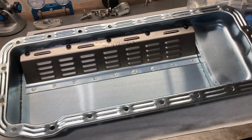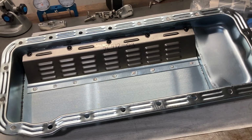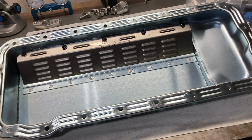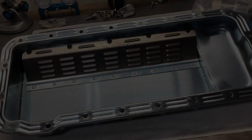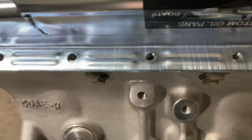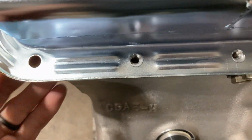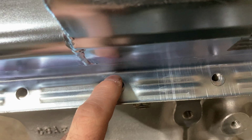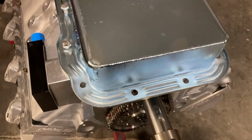While the engine is upside down, I will go ahead and retorque everything on camera so that you guys can double check me, and we'll check our rod side to side clearances and that sort of thing. But let me get some of this taken apart. And this seems to be par for the course. Got all the bolts started on this side, but they won't start on this side, so I'm gonna have to take a die grinder and open these holes up. Good times.